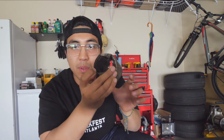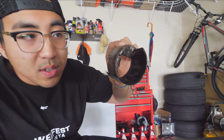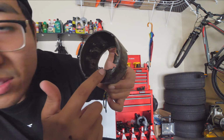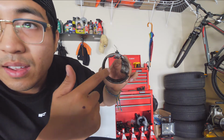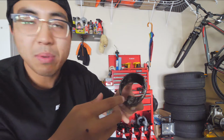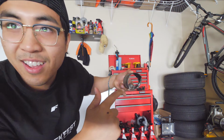And then this is what gave me the hardest time. So what I ended up doing was me and my homie, we just made a relief cut, and then we chiseled this piece up until it folded up like that. And the idea was to be able to get a flathead underneath and just kind of pry this out, but that didn't work. Somehow, torching and letting it sit in PB Blaster and having a lot of conversation while on the floor dirty, covered in differential cushion, rubber, silicone. All of a sudden the PB Blaster did its work and it started pushing it out while we chiseled this out. So basically this became the point where we just punched it out.